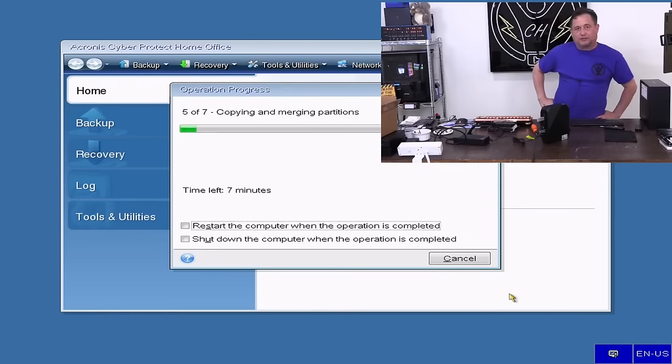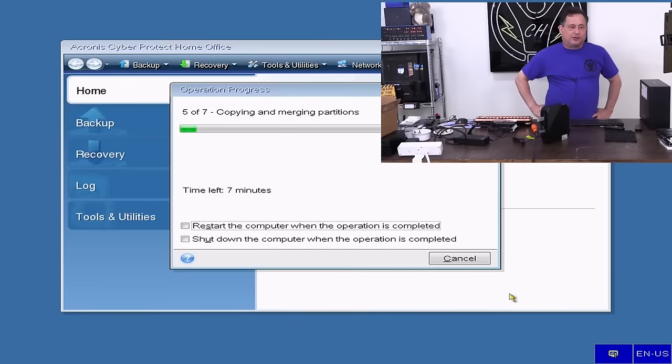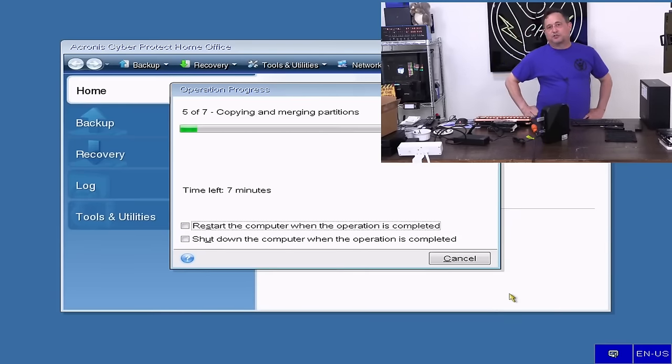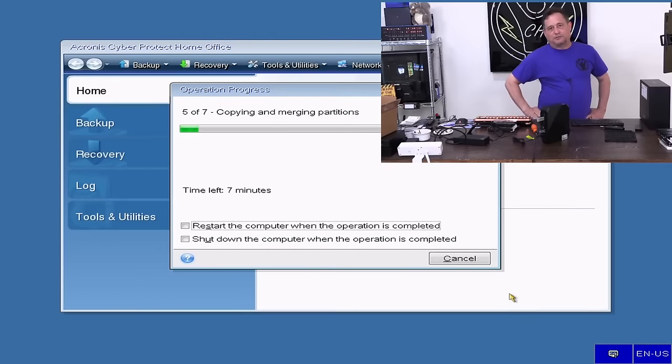And there's some machines where they won't boot, as we've just experienced with the Windows PE. I see people, sometimes they have these Dell computers and they have trouble cloning their system because they don't realize Dell ships the, especially the business class machines with the drive controller in RAID mode, even though it's only one drive and it's not using RAID. That's Dell's preferred method. And because it does that, Acronis cannot see the RAID controller. You've got to go into the BIOS and change it to AHCI, and then Acronis will see it, but then the system won't boot anymore and cloning the image won't work. So this has created a lot of confusion for people.